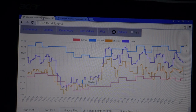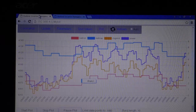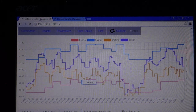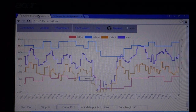We're approaching end of charge now, and it starts doing some interesting things. We see it ramp down, and it does it again — it ramps down to zero pretty much, and then it ramps up again to six, and then ramps down again. I wonder if it does the same kind of charging curve in a regular Leaf. Maybe it does it to sense the unloaded cell voltage — it ramps it down to zero, checks the cell voltage, then ramps up again. Could be interesting.